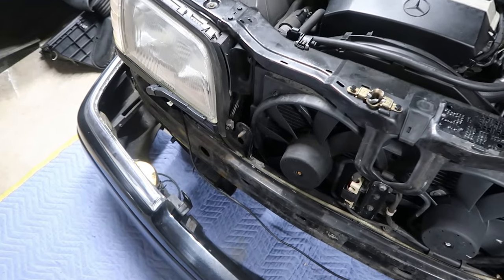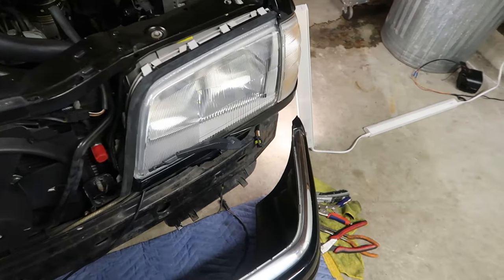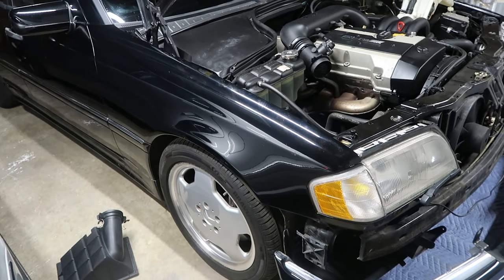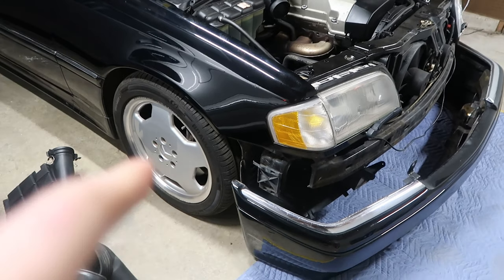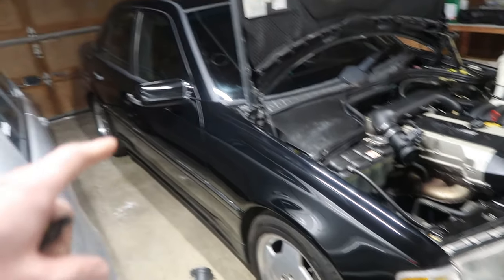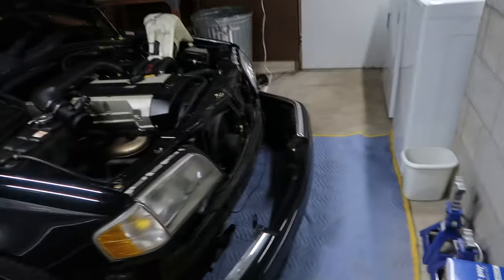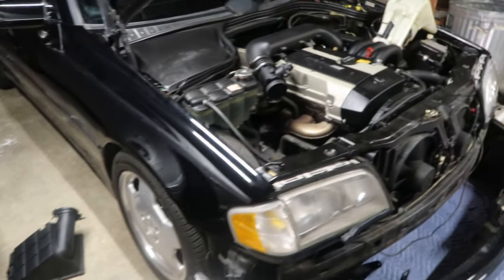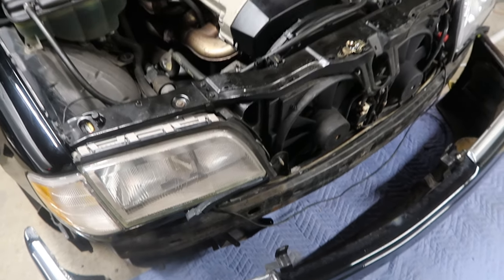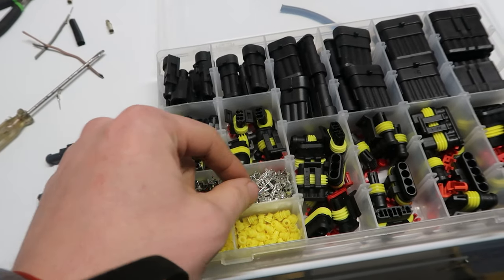Once I get this last black wire connected, I'll clean up the front bumper area, spray some corrosion inhibitor on it, and get the bumper mounted. From there, I'm going to try to build some plank ramps tomorrow at work to get a couple inches of clearance for the jack. For those who haven't used these little waterproof connectors — there's a male prong and a female terminal. You slide little yellow grommets over them and insert them into the connector housing, making sure the notch on the prong catches to lock it in. Pretty simple.